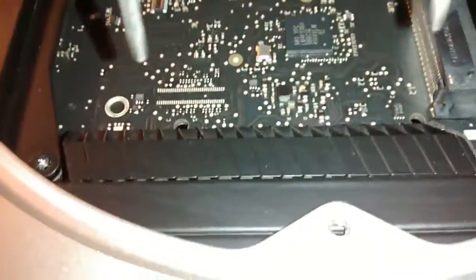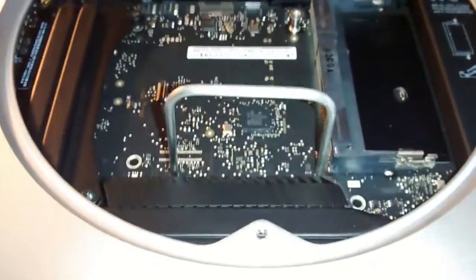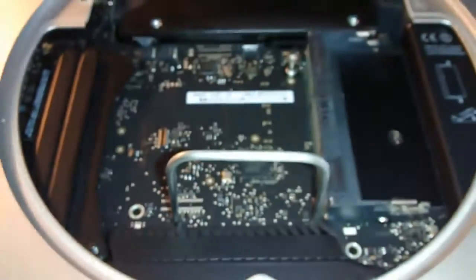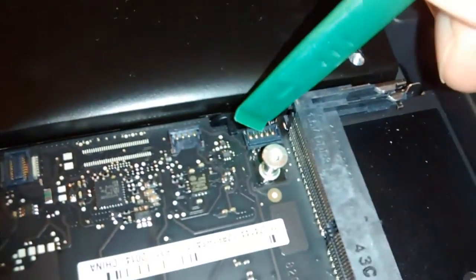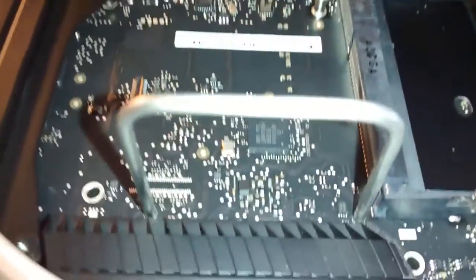What you do is put that inside here. You may have to stretch it a little bit. Put that in there. Slide the logic board back a bit. So that's in those two holes and then you pull back in this direction very gently. The next step is to remove this little infrared module connector here, by lifting it up. It's quite fragile - that's just that little black connector in the middle.